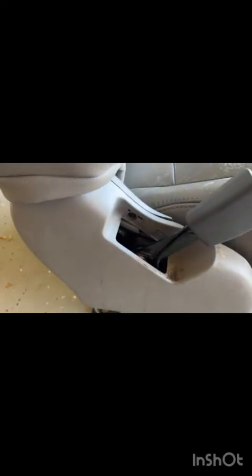That goes right here by the seat belt. So take your screw gun or your number 2 Phillips screwdriver, spin that guy off, and just to show you a comparison of the thread pitch of that guy versus the others, if I can get it to focus there. I don't know if you can really see that, but yeah, much coarser thread pitch on just that one because it screws into plastic. The rest screw plastic into metal.